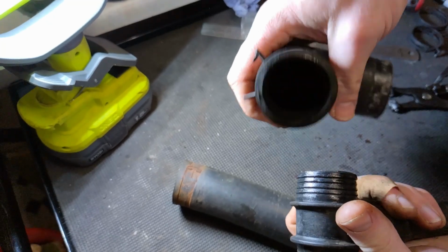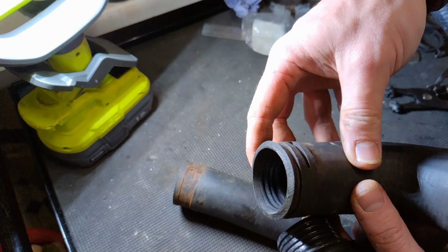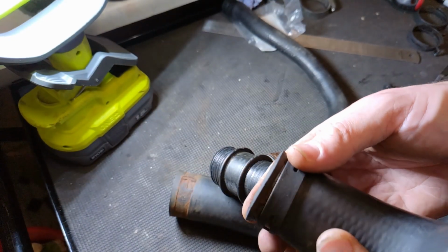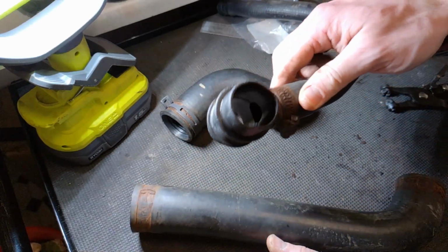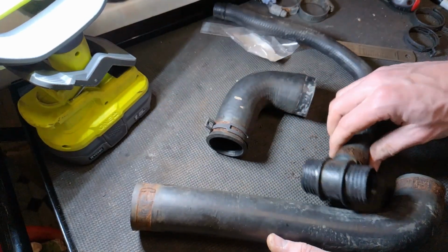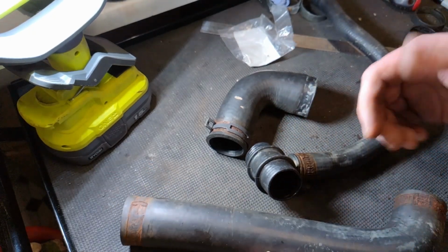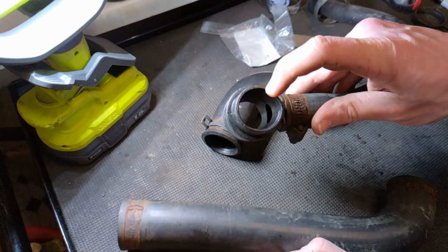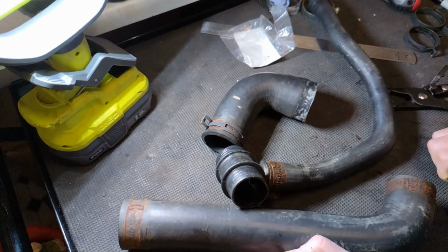Well, that can pop off with quite a lot of force. See, the hoses are pretty much moulded to these now. See how much that's clamping now that it's off. It's splurging out. What do I do? Do I put new clips on old hoses when these are effectively slightly squashed and the hoses are moulded exactly into the position they were in? Or do I buy a new one with new cheapy pipes where these may be squashed from the factory because they've got worm drive hose clips on? Or do I just fit the genuine hose?